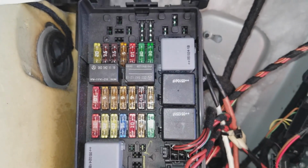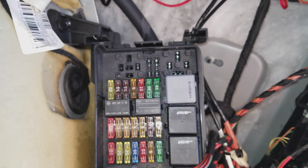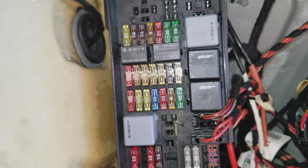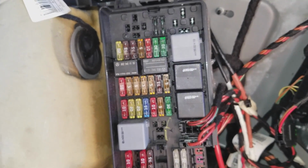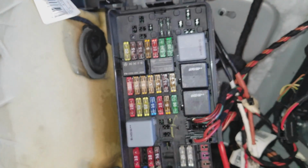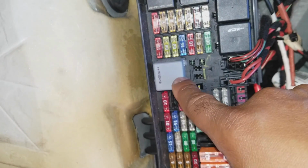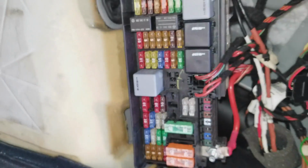I do not recommend doing that, because if you blow that relay, then all the functionality from that relay is also gone. So what I would do, I would just take this relay out, take it to your Mercedes dealership and get a new one. They're not that expensive, and I'll put the links to that down in the description below. But if all your fuses are good, you're still not getting any power, this relay right here is bad and needs replacing.